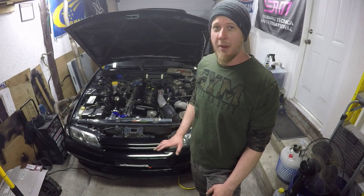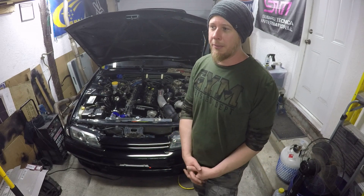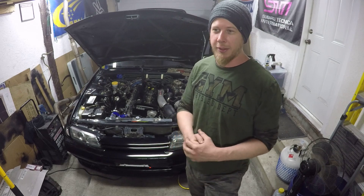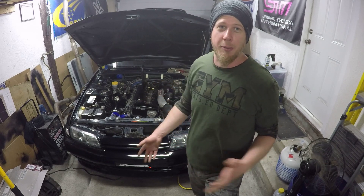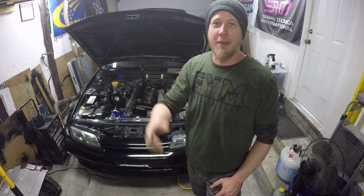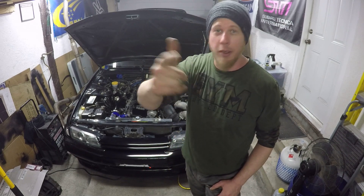It does have a bunch of goodies in it — I'll try and list them in the description below. It doesn't have a very large injector, so I'm not even sure if 400cc is stock or not, but should be able to get a little more power or clean up the power band. It does have R34 turbos on it, so there's something the tuner would be able to work with. I just basically have to put this all back together. If you liked this video, give it a thumbs up, and if you're new here, please consider hitting that subscribe button. Leave your questions and comments below, and I'll see you in the next one.